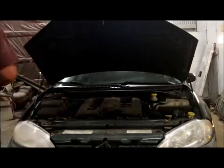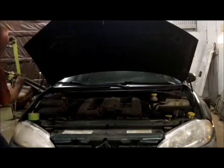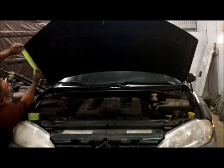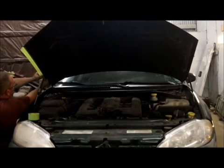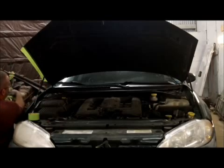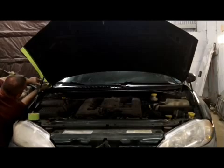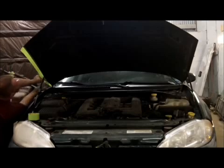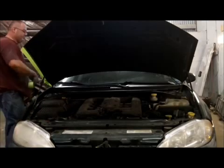So, let's go down the sides of it with 2-inch. You want to leave as much exposed as possible on the outside edge, so usually I go in about a half inch on the inside edge of the hood. That leaves us about 1.5 inches, roughly, of exposed tape for our paper to stick to. Go along the back side.